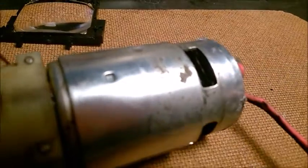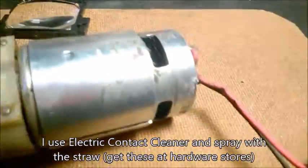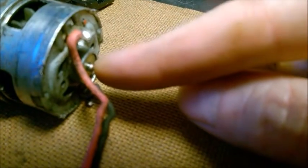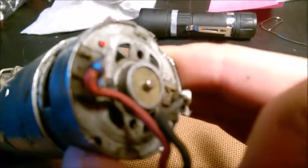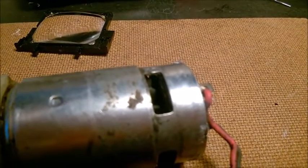What I'm going to do now is try to reach the rotor, maybe with a q-tip — I'm not sure if I can. I'll try contact cleaner. You may try to spray small amounts directly on the rotor and just rotate it. Also try to put a droplet of engine oil over the small shaft when you're finished, and keep it vertical so the oil drips down, because you're going to dry out the bushings. It's not a bearing, it's a bushing over the shaft, and you want it to be lubricated.